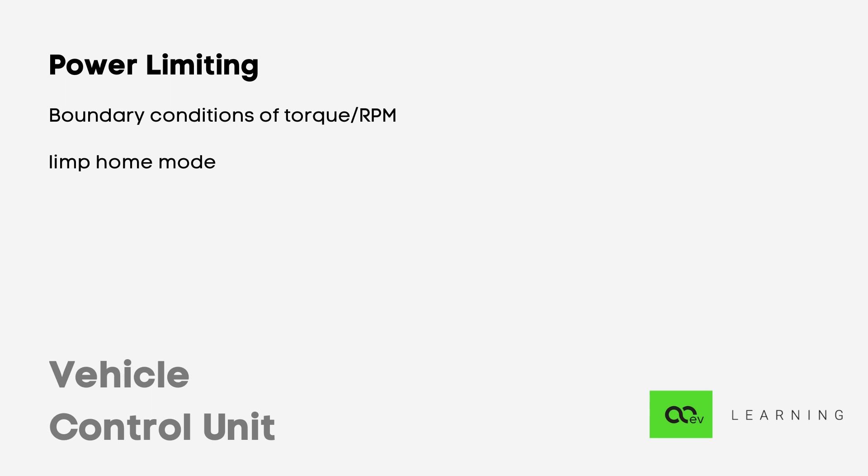There is another unit which takes care of vehicle stability — the Electronic Stability Program. The ESP, which is the successor to ABS, also has control over the powertrain along with the brakes. In cases of possible rollover, loss of traction, excessive lateral acceleration, wheel slip, or wheel lock — basically any condition where the driver feels they have lost control — one way to regain control is to selectively brake each wheel depending on the yaw moment the vehicle is experiencing. Along with this, it is prudent to reduce the input power as well. The ESP demands the VCU to limit torque or RPM, which the VCU must adhere to — another form of derating the VCU has to contain before producing the goods.